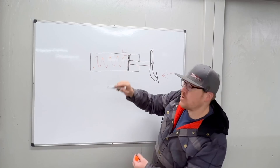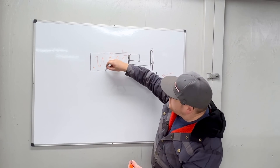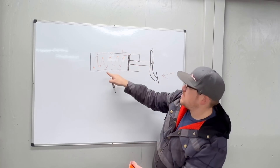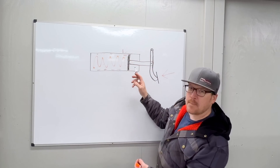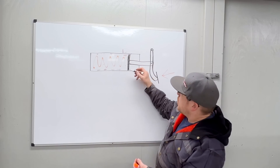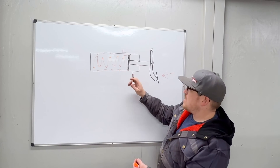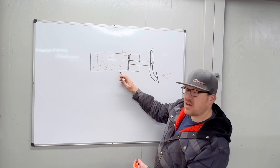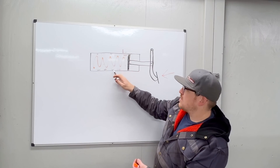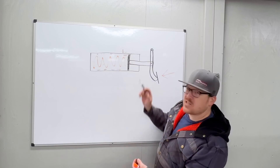But back in the rear section of the cylinder, if you don't replace your brake fluid and you get a lot of moisture, you start getting corrosion and rust in that back part of the master cylinder because the piston never travels over it to clean it. So when you go to bleed your brakes, you crack that bleeder open, you push that pedal all the way to the floor, and that rubber seal just gets dragged across all those high spots. It can tear off a piece of that rust, get stuck on the seal, completely tear the seal, or the seal just won't seal up on the rust — and you have a soft pedal. That's why this happens.